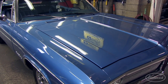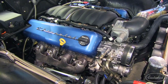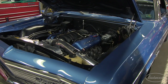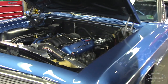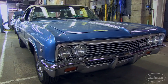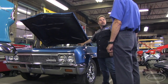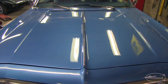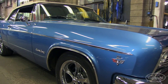There's a Super Sport with 327 badging, but it's actually an LS3. The customer bought this car new in 1966 and brought it in for modernization: LS3 engine, 4L70E transmission, Global West tubular upper and lower control arms, coilovers, four-link in the back, nine-inch rear, four-wheel disc brakes. The Holley valve covers with the Chevrolet script cover the coil packs, giving a nice balance of old-school appearance with late-model performance. The shop tries to keep with the era while modernizing the drivetrain.